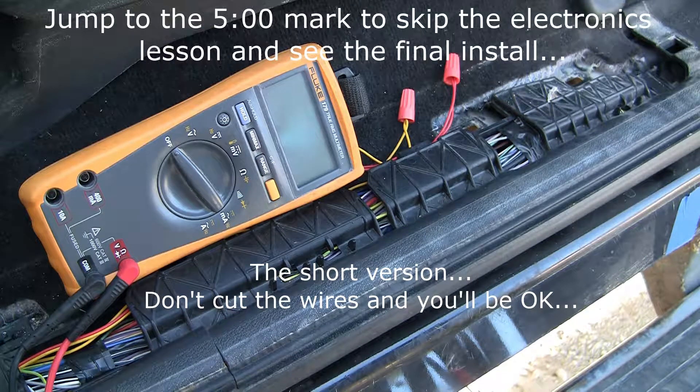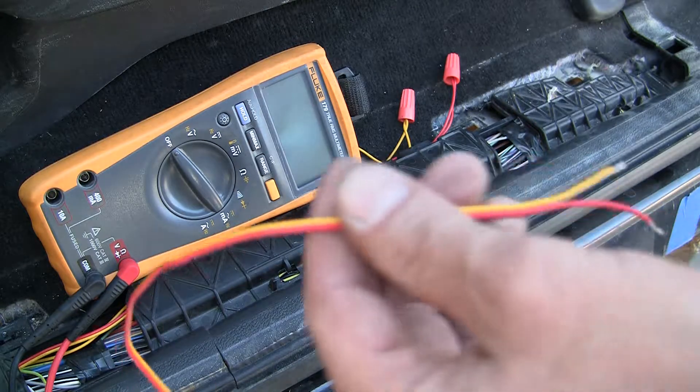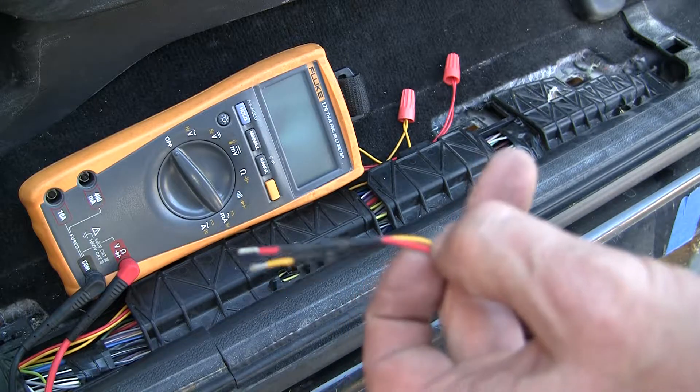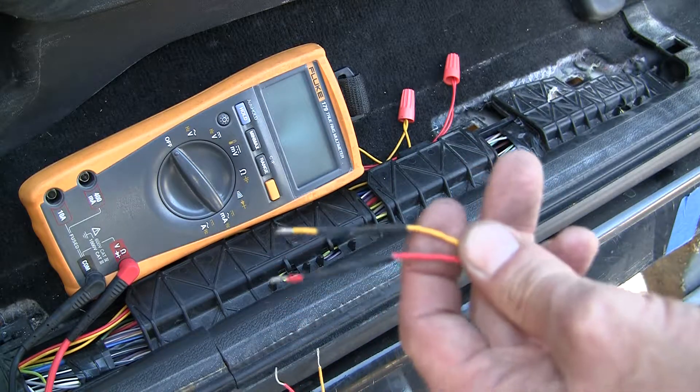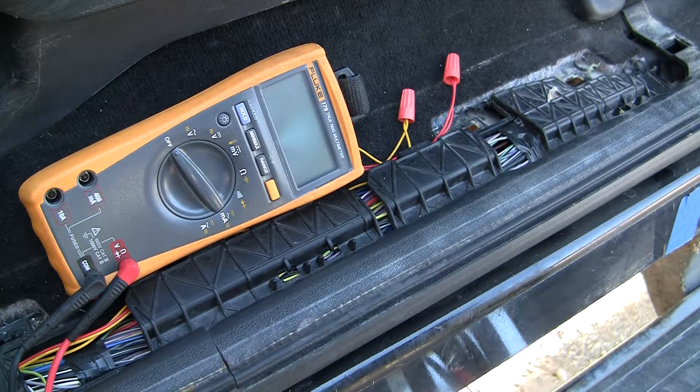Because I did not run my wires all the way to the front — I'd have to take the grille off, pull the headlights out, and connect them to the headlight wires as the instructions say. Since I had such a short run, I had all kinds of wire left over, and in the process I just cut some off. I should have stopped and thought about what that wire was, but I just cut it off. I've since found that if I disconnect the Big Rig Ice running board and turn signal lights, the side marker lenses will work.